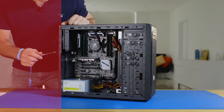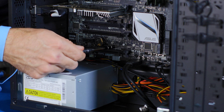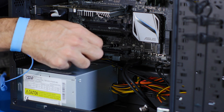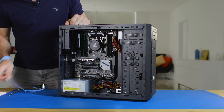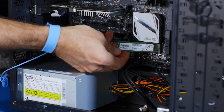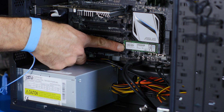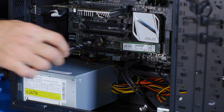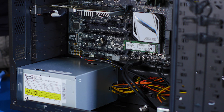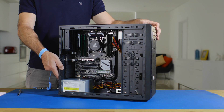So let's get started. The first thing we need to do — this is an ASUS X99A motherboard, and mine came with a screw already in the standoff for the M.2 socket. The M.2 socket is here and the screw is here. I'm going to take that screw out. Here's my SM951 — I line up the slot on the SM951 with the guide in the socket, wriggle it in at an angle, then put the screw back into the 80mm standoff. That's how you install the bare M.2 drive into this motherboard.